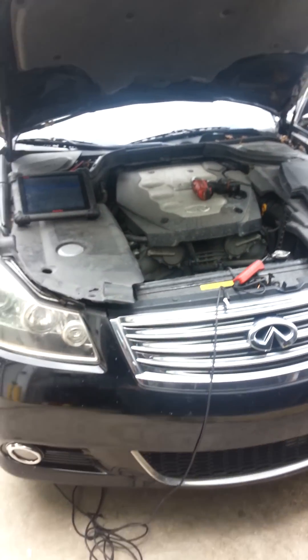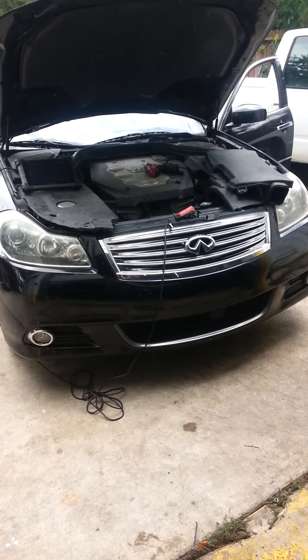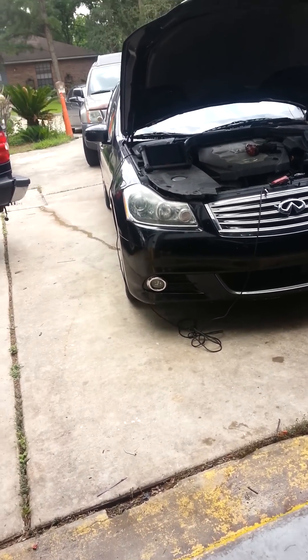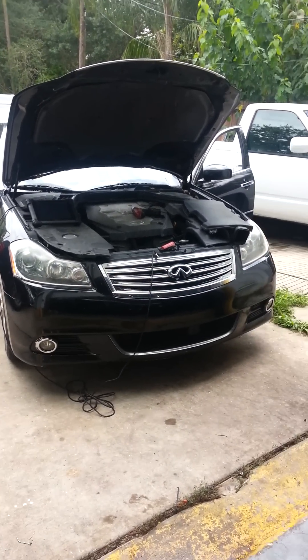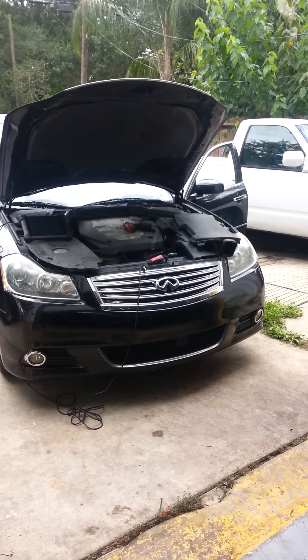Basically the issue on this one is going to be the control module — it's stuck on the whole time. So we just need to get a new fan assembly and that should fix the issue. The main thing is I know the fans are on. What we don't want is for the fans to short out and cut out while driving. Those fans should only turn on when commanded, and right now they're not commanded on.